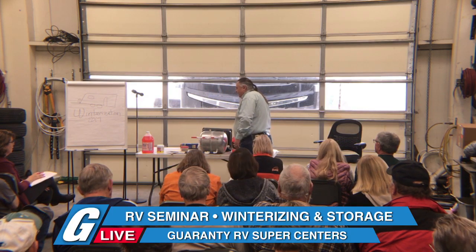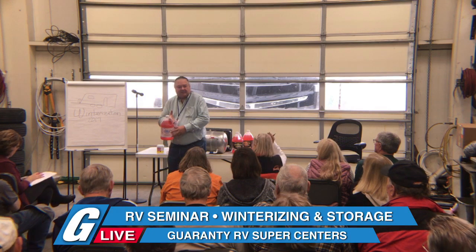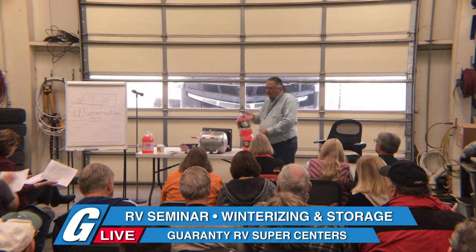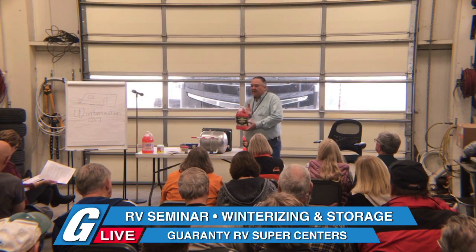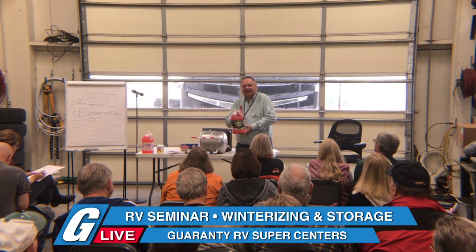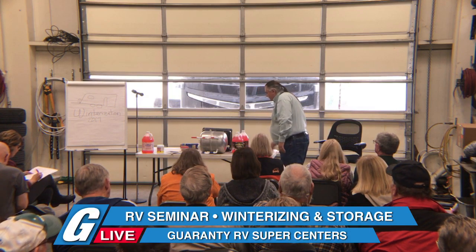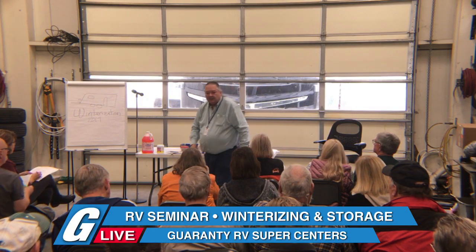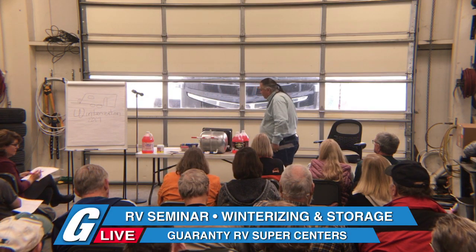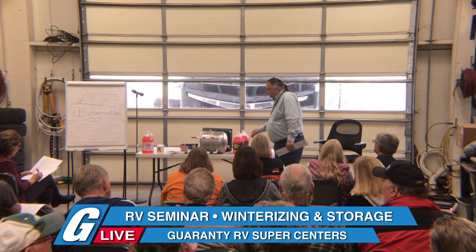Okay. So, there are two kinds of this stuff while we're talking about this. This is boiler fluid. You don't want to buy it. This is for the people with hydronic heating that we're not going to talk about today. This is regular RV antifreeze, everybody sells it. And once in a while you see somebody selling it concentrated, just add water. You don't buy the concentrated, just buy the regular RV antifreeze. That's not engine coolant. This is RV antifreeze, but it's a misnomer. It actually freezes, but it doesn't expand, and we talked about that.